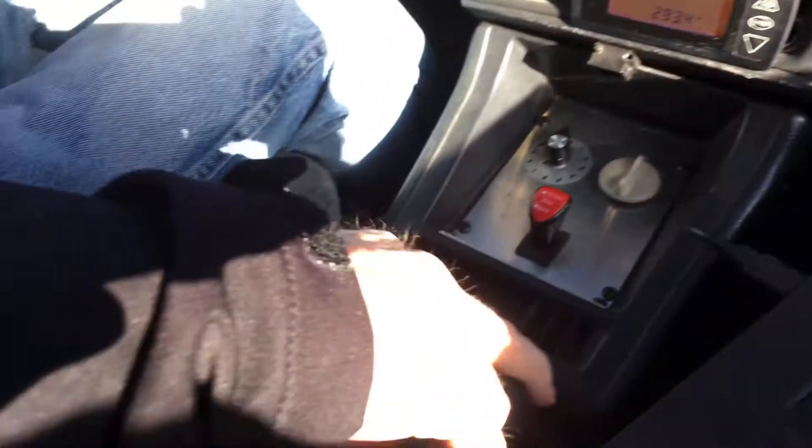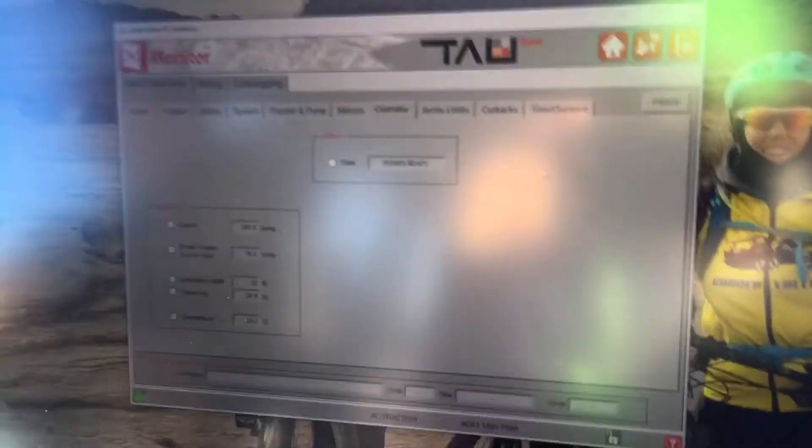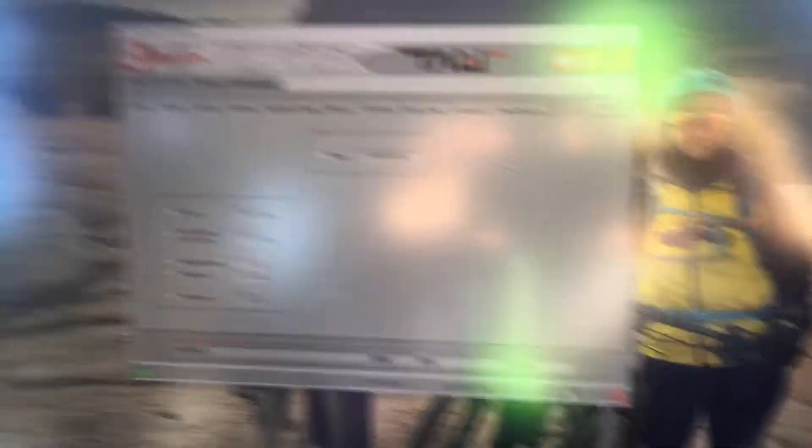Usually when I come back into my place the dirt road has just a little bit of a hill here. Just to make it easier on the system, I'll stop right here at the base of the hill and put it in low range, which is just here on my right-hand stick. The left-hand stick is the two-wheel drive / four-wheel drive. There was a little ice — it spun out just a little. We may have to go to four-wheel drive to get up the hill here. I put the twin stick kit on this transfer case so that I could run in two-wheel drive low range during dry weather, and that's worked out really well.